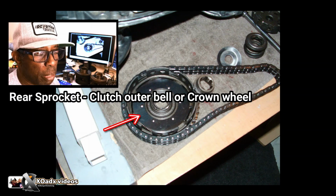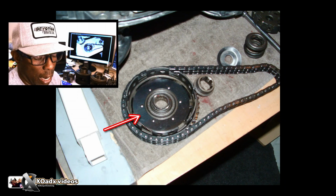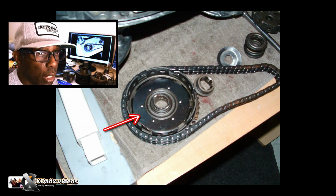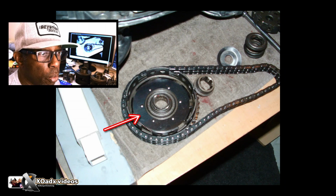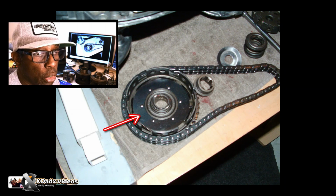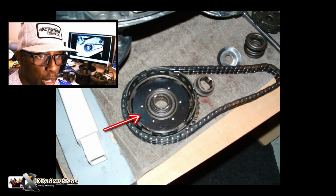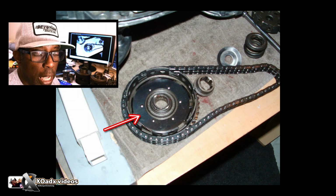When you're going into gears, it makes everything not lock up. The wear and tear on the motor is a lot better, I feel. I'm using it on a 150, so I'm just sliding in there. But the minute you kick that motor up to over 150 cc's, put a pipe on it, anything, you cannot use that part. You need to get a more modern clutch bell, the one that doesn't have the spring in there, because adding power to that part will blow it up.